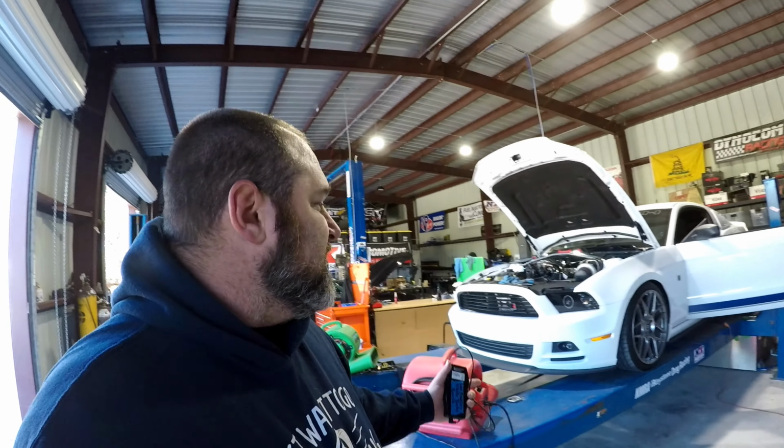We're gonna push this car to about 450 horsepower on 93 octane. Maybe we'll see if we can squeak it to 500, and then we're gonna swap it over to E85 and push it up to 500, 550, give it a nice safe daily tune in the low 500s, and send it home. It is a manual transmission car, super clean, looks fantastic.